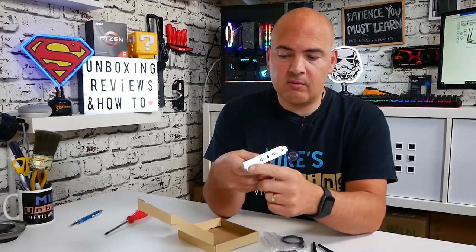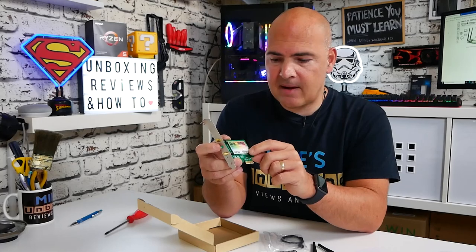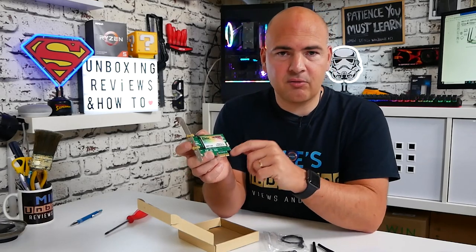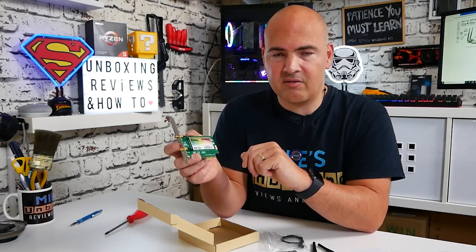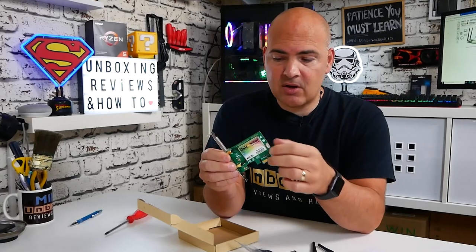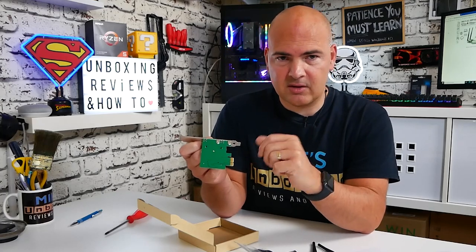Looking at the card itself, on the rear you've got the retention plate and also where the screw goes. You've got a pair of connections for antennas or aerials. The actual Wi-Fi part of this is based on the Intel 7265 chipset, which is a pretty universal chipset that's been around quite a while and is very reliable. Speed-wise, you're looking at up to a theoretical 867 megabits per second on the 5 GHz networks, and 300 megabits per second on 2.4 GHz networks. Towards the rear of the card there is a little port where the USB cable plugs in, and that is for the Bluetooth section. The only thing I dislike about this card is the fact it's on a green PCB — it would have been really nice to have seen it in a blacked-out version, but because it's going to be hopefully at the bottom of your PC, it should generally be covered up by things like the graphics card.